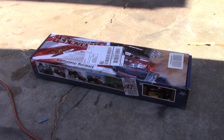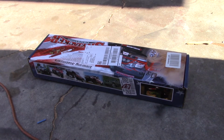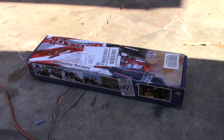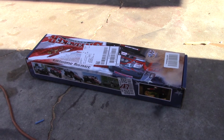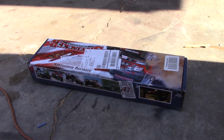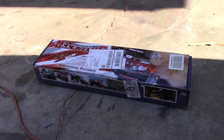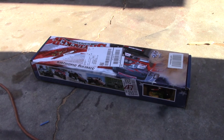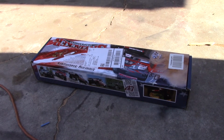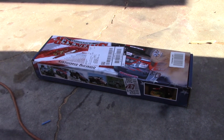And I'll go into detail about steering stabilizers, why some people on the internet, on the Bronco forum, say you don't need them, but I completely disagree with that, because they're designed to absorb impact. You shouldn't use one to fix a steering problem. If you have a death wobble or something crazy like that, that's some other steering component. You should probably get that fixed or looked at. Alignment issues, pulling, all kinds of stuff, never use it to fix steering problems. They're just to absorb impacts. I'll go more into detail on that, but let me show you this real quick.